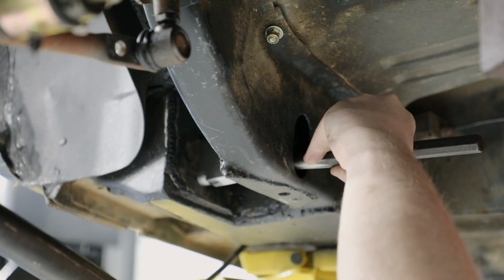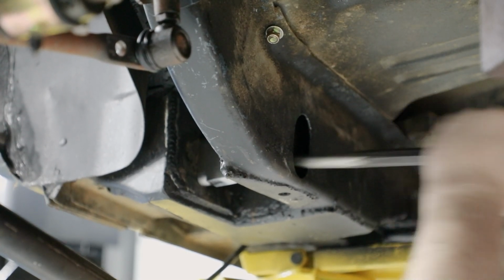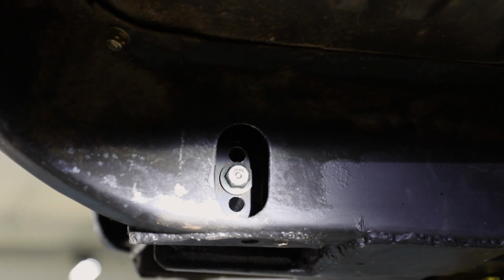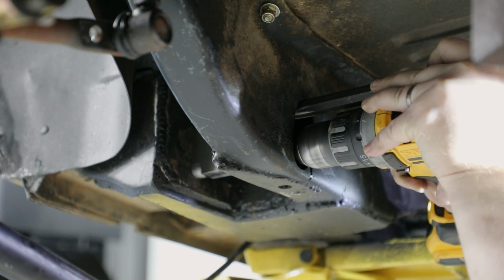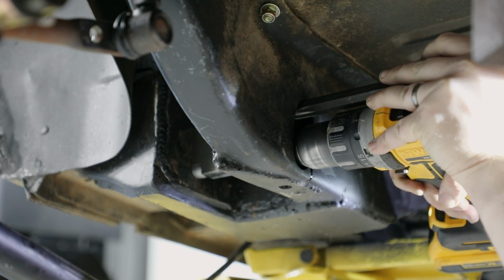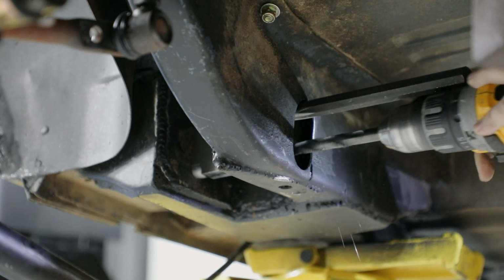Use a drift to align the inboard lower link hole that was just drilled with the bottom hole in the drill fixture. Tighten the M12 hardware to keep the drill fixture from moving. Place the drift in the top hole of the drill fixture. Drill the outboard side of the link pocket using the bottom hole in the drill fixture using a 31/64 drill bit. Use cutting fluid and slowly drill through the link pocket.